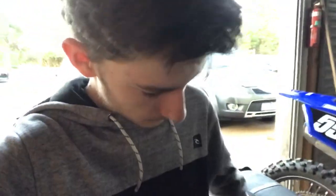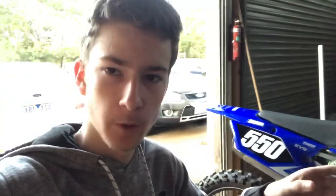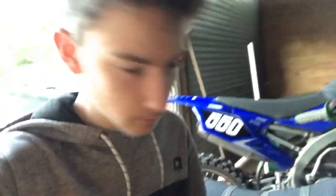Now that your suspension is sorted, you're going to want more power. So the first thing I'd get for more power is a new carby. The carby on this bike is pretty good — it's a Mikuni VM26, a 26mm carb. But most Chinese bikes come with a really small, cheap carby that'll be limited or jetted differently because of emissions regulations, so it'll run as lean as possible without breaking the bike. Fit a new carby — it can be a Chinese one off eBay or Amazon — it's pretty inexpensive and that'll give you a lot more responsiveness for wheelies and stuff.